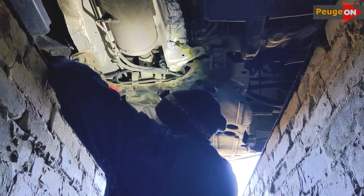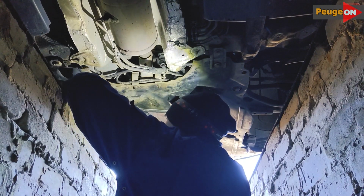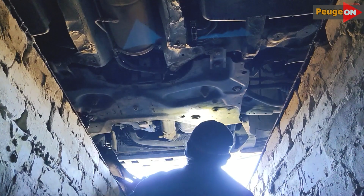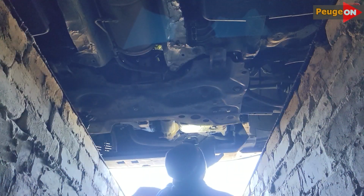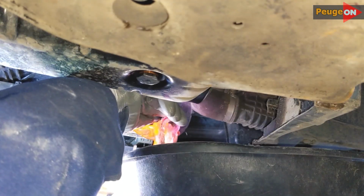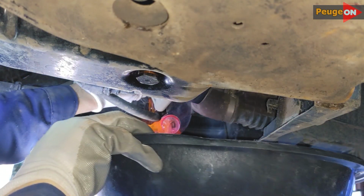Drive the car onto a pit or a lift. If the engine is warm, wait about 1 hour and drain the antifreeze. I will not go into detail about the draining process. There was recently a video on replacing antifreeze in an HDI engine. Everything is very detailed and thorough there. All links are in the description.